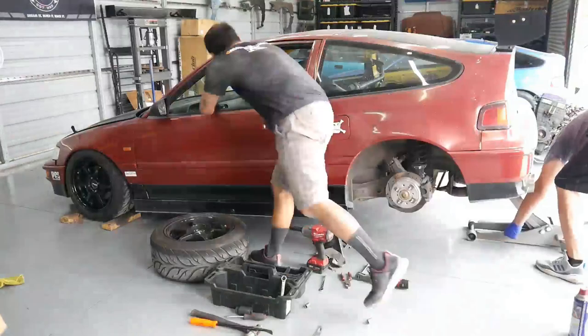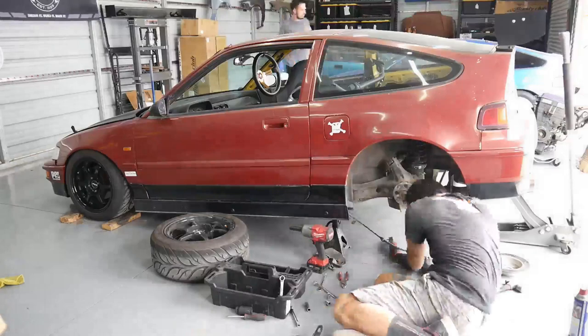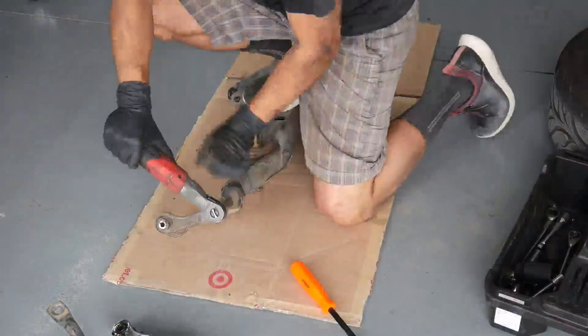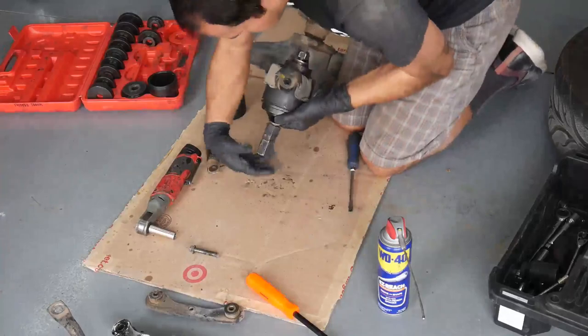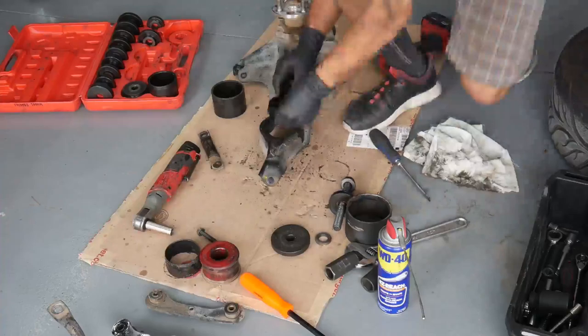The way I thought to do this was to remove the rear trailing arm completely off the car. I didn't see how I could put the PCI bushings in with the trailing arm still attached to the control arm and upper control arm. With that off, I needed to take off the compensator arm and then get that energy suspension bushing pressed out. I tried with a screwdriver first but that wasn't working at all. I decided to use my bearing press kit - that made it a cinch. I put a longer sleeve in the back, slid it in, got my impact gun out, and just pushed that bushing right through. Very simple to get it removed, then just hammer the sleeve out.